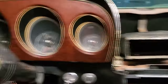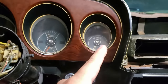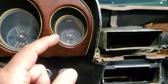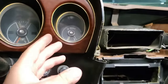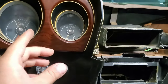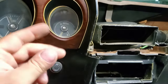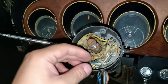Put your turn signal on and you should see that light illuminated at all times. If you do not see a light, then you have other problems. What you're basically doing is bypassing the flasher, so it's going to feed constant power and the turn signal light will stay on. All the flasher does is, it has a little element on the inside — like a little resistor — and whenever it gets too hot it flinches and releases, your light turns off, then it cools and touches again, turns the light on, and just continues repeating over and over. That's potential problem number two.